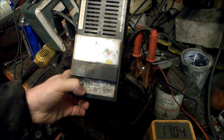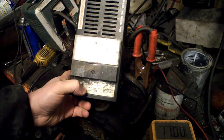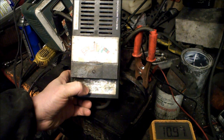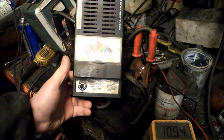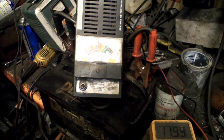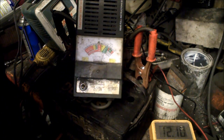According to this, it's showing roughly just a little under 200 cold cranking amps, and I'm at about 10.97 volts at a hundred amp draw. Kicked it off and it jumps right back up — we're over 12 volts and climbing.